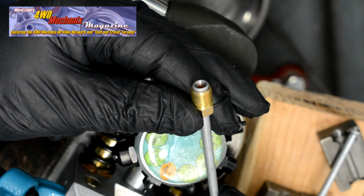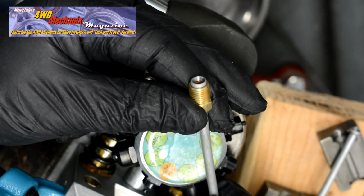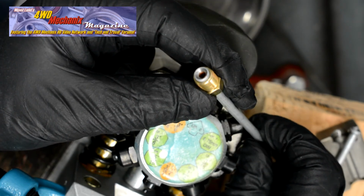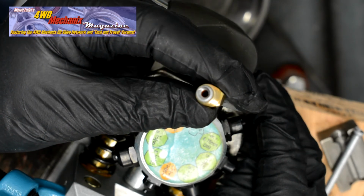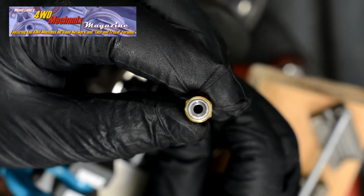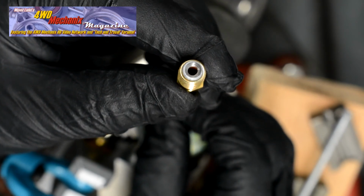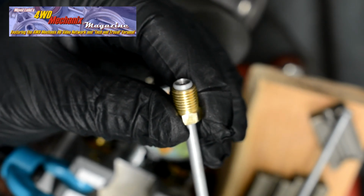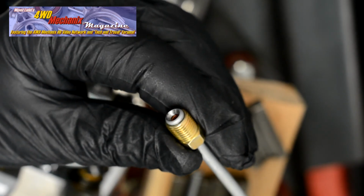The outside diameter of the flare is ideal for this 3/8-24 flare nut used with a 3/16 inch double inverted 45-degree flare. This looks right and will provide a safe and secure joint for a brake connection, or hydraulic brake system PSI ranging from peaks of 2000 to 3000 PSI. There is no room for error, and these joints must seal perfectly.